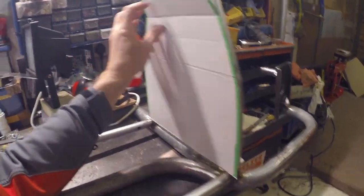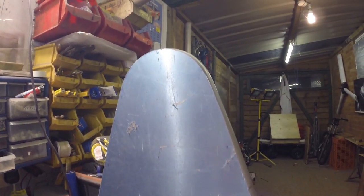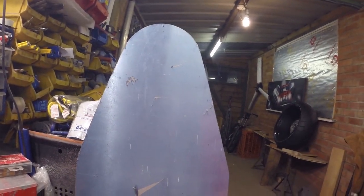Slight change of gear — I'm thinking about the backrest now. I've cut myself a template and cut it out of a piece of aluminum sheet. After a lot of cutting and filing, there is the backrest. My next job was to temporarily pop rivet it in place — I was going to put a couple in, but what I'm going to do instead is pop some riv nuts in, which will allow me to just bolt it on and then unbolt it for when I'm respraying it.